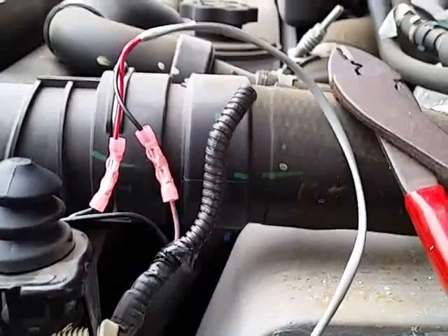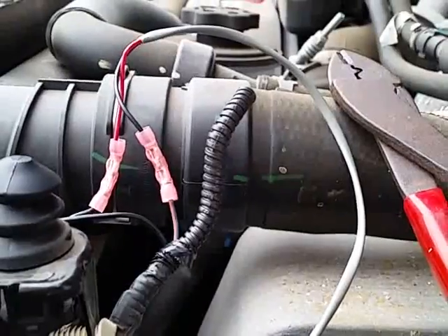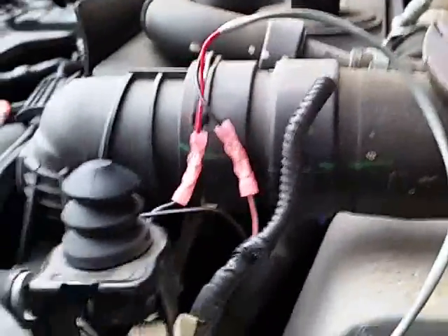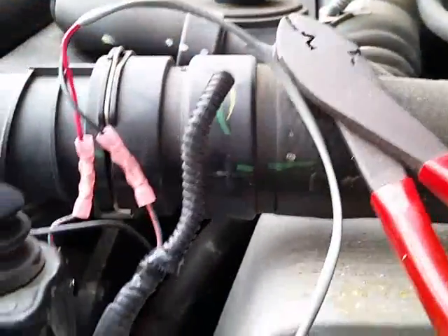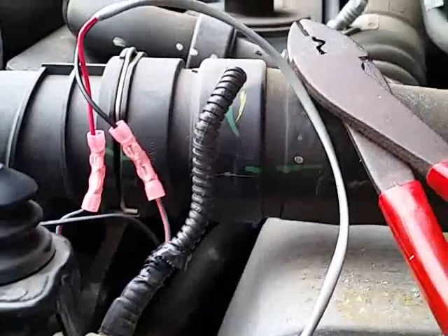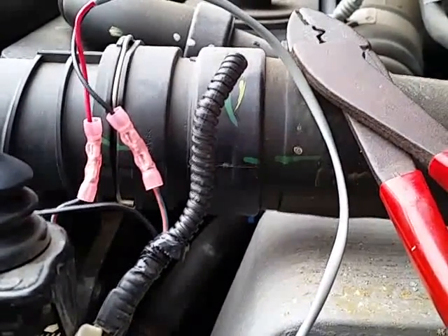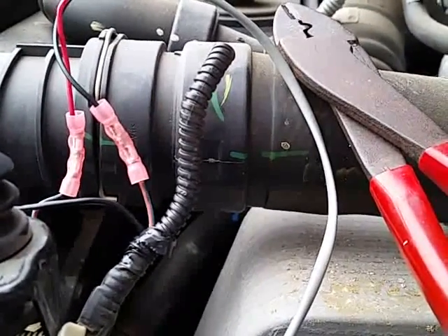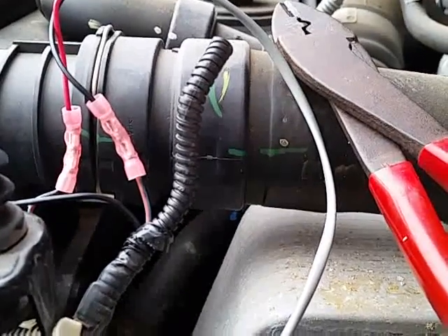Just as a quick disclaimer, I normally solder all my connections. Unfortunately my soldering iron was borrowed and never returned. So I'm using crimps, crimping correctly from the back side, and using some nice Klein splices to do the splicing — I squeeze them pretty tight. I'll also be wrapping everything in 3M 33 electrical tape to make sure the connections don't come loose. There's not going to be any pressure on them, so I don't think I'll have any problem.